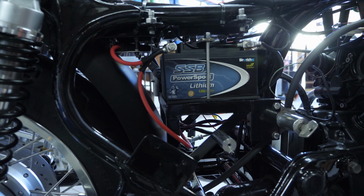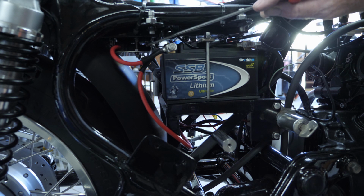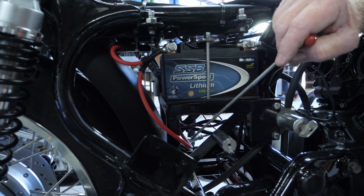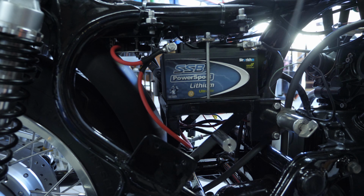Over on the right hand side of the bike, we have the battery from the positive terminal coming out, going through the 30 amp blade fuse holder there and into the power supply for the M-Unit Blue. On the other cable, which is going round to the solenoid through the main fuse and powering the starter motor and the ignition switch, which is constant power.